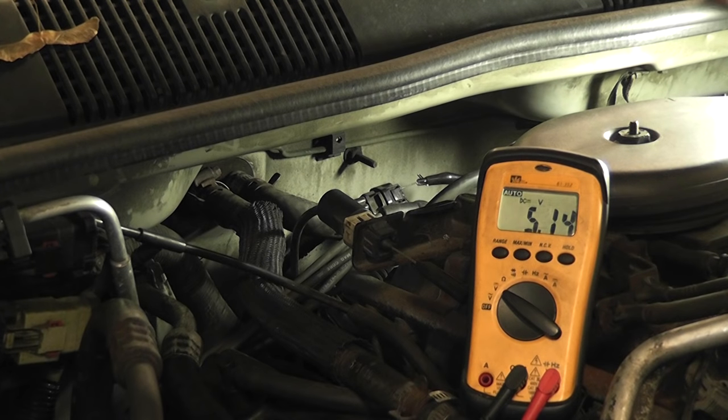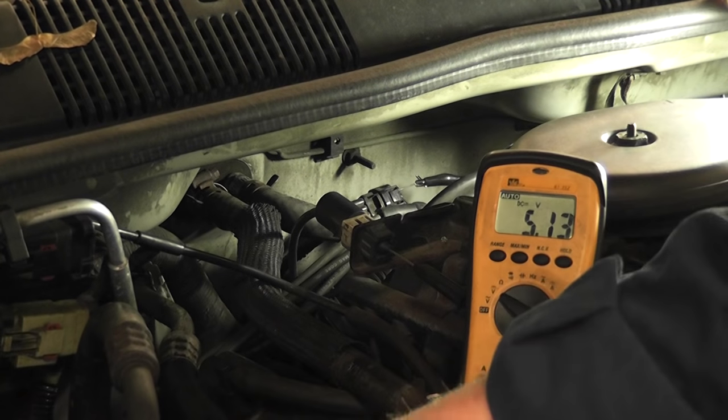What's the maximum number this Hall Effect is producing? It's five volts. The minimum number you saw was like 0.04. And there's your high-low signal — this is what you would do with a voltmeter. With the engine running, it's going to be the same thing; you're not going to see the high-low signal. So I'll show you what it looks like with the engine running.